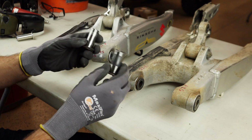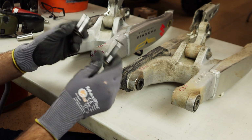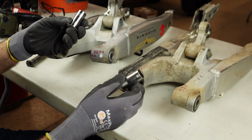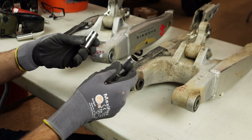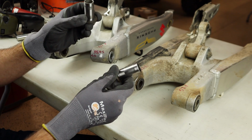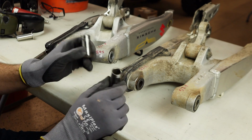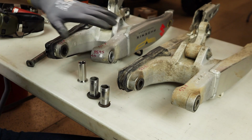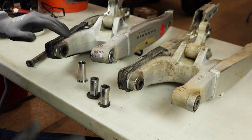And I also found that both of these are the exact same size in both swing arms, regardless of 2-stroke or 4-stroke. Mind you, one's an '04, one's a 2020. There's a pretty big gap there, but like I said, they won't spend any extra money if they don't have to. At any rate, this is really good for us. Not only that, but if this is the same and this is the same, that also means that the chain and the sprocket are in the exact same place we want them when the 2-stroke goes into the 4-stroke. So that's already done. That's a huge deal.